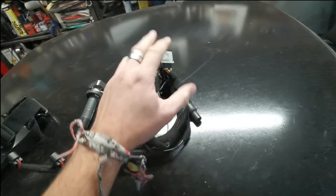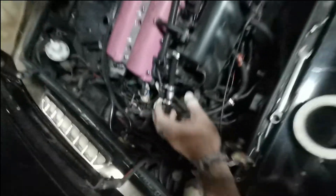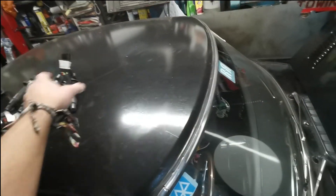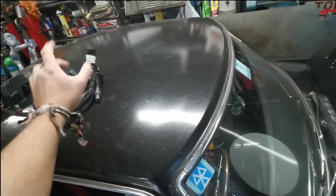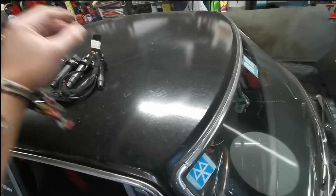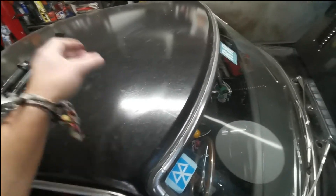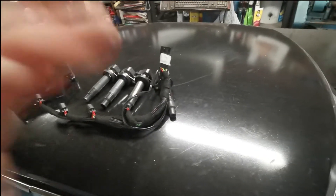These two will go into your standard wiring harness on the car. The coil pack wiring harness connectors are generally set up on the standard car as one, four, two and three. On waste spark it'll be one and four, two and three. They'll be labeled up — coil one and four, coil two and three. If you go for sequential it'll be labeled one and two, and then your breakout loom will be three and four, which goes to your ECU. Again, plug and play.